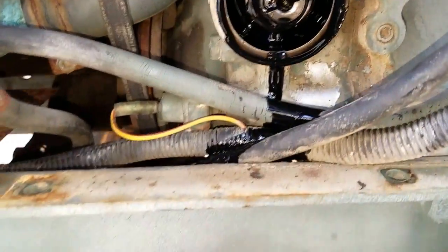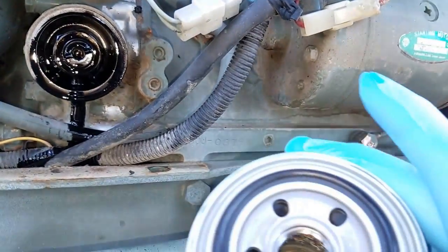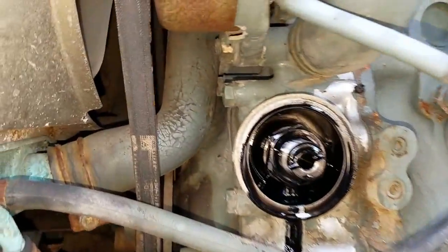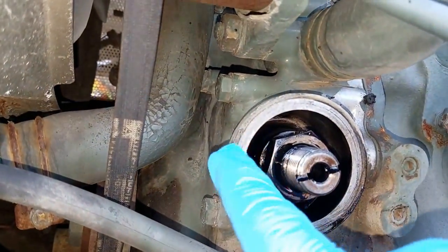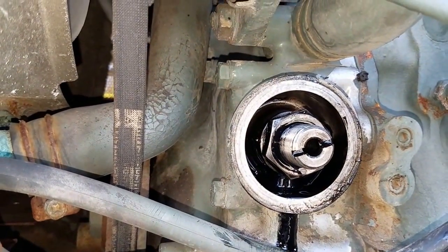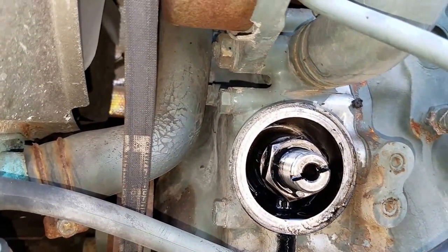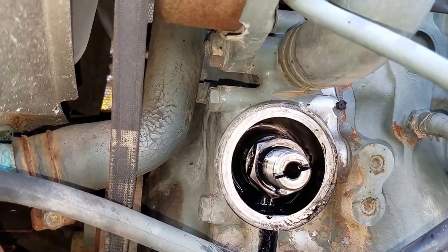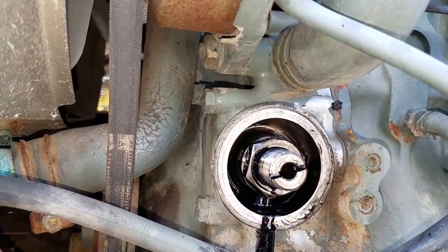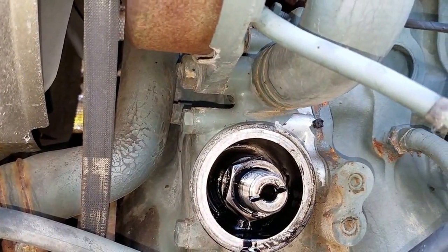I've got the filter off. You can see the oil coming out of where the filter is, dripping down — of course making a mess, but that's part of changing oil. One thing you need to make sure: here's the new filter, there's the gasket right here. Make sure there's not an existing gasket left on the mounting surface — clean that off. That gasket's going to seat right against there, so it's important that you take the original gasket off. Sometimes when you take that filter off the old gasket gets stuck and it just looks like oil, especially if it's dark and you're doing this at night with a light. If you leave that gasket on and put your new filter on, ten minutes after starting it up oil is going to start gushing out of there. You'll take the filter off and find two gaskets — that's what happens. So make sure that rubber gasket is off of there and clean it all up.